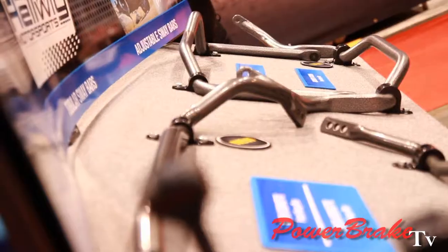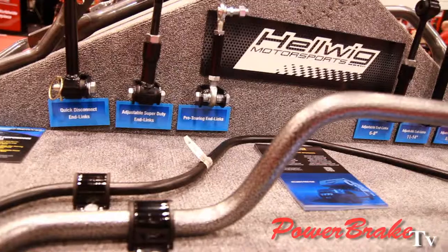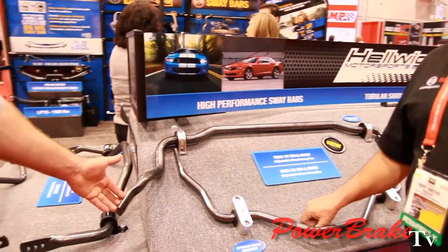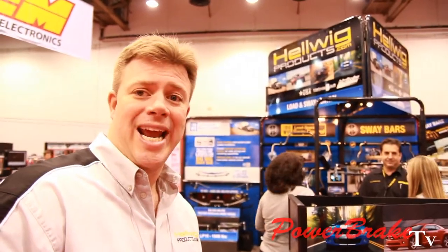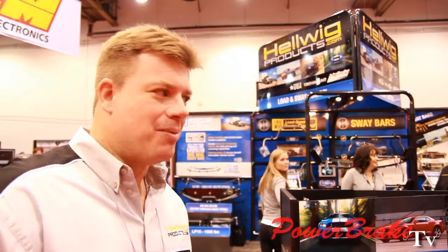And you've got full coverage for the Chevelle, Camaro, and Mustang crowd? What we have here is our new adjustable front sway bar for GM A-body applications for 1968 to 1972 model years. It affords three-hole positions so you can tune the rate of the sway bar to match your needs. This is great for somebody that wants to autocross or is looking for the ultimate handling — it's the only one on the market right now and allows you to match suspension upgrades to your driving style.